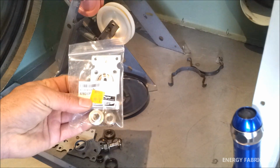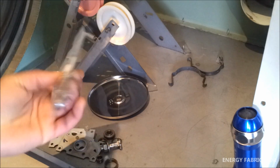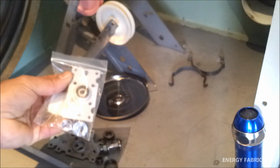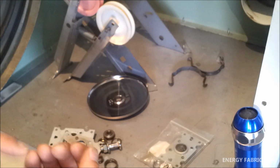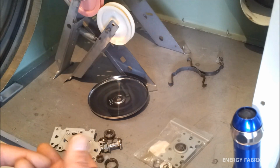So I went and purchased a drum bearing kit. That's got the bearings and the spacers. This one here is actually slightly more tricky to install than most units. Generally, there's a lot of types of drum bearings. Some of them have a little cup and a ball situation, and that sits in the bearing and it just literally drops into place. Some of them have a little shaft with a rounded edge, and you put some sort of sleeve on there with some lubricant, and that sleeve sits in the bearing.